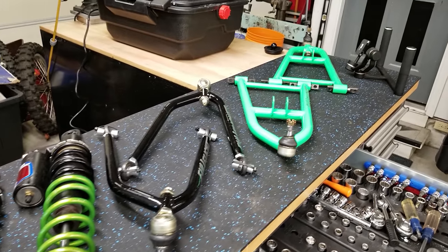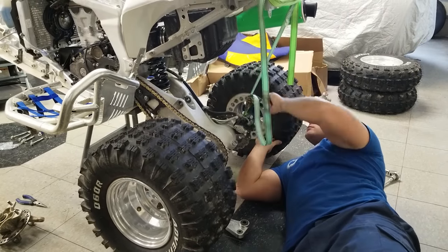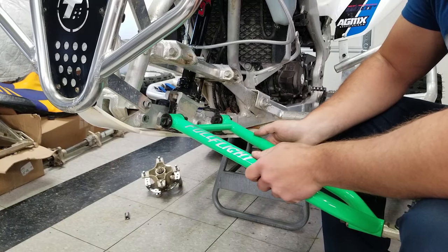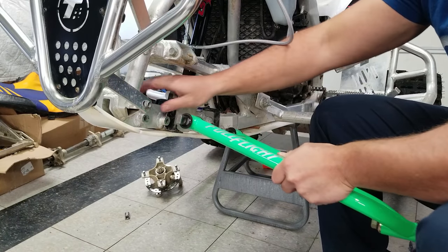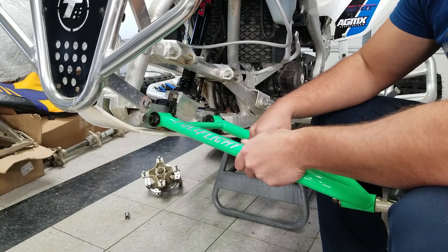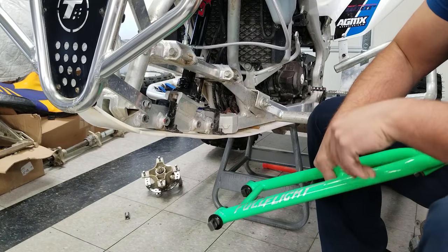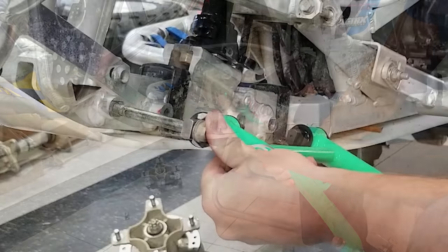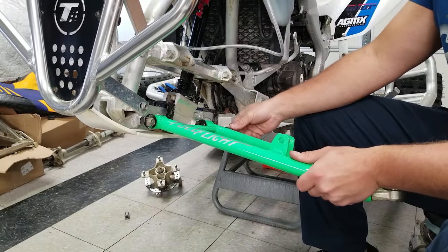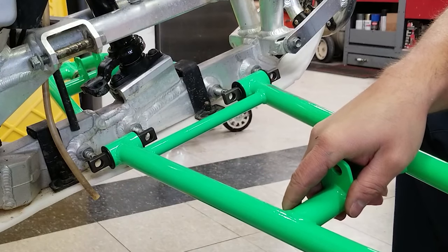Let's get the suspension and A-arms on. The first thing I did was install the rear shock - nothing really crazy here, pretty much just slides into place and bolts up. I won't be tightening down any of the bolts on the suspension until there's some weight on the machine. The KFX has kind of an interesting system - usually you have A-arm bolts that go through like this, but because it's such a narrow frame they decided to do it differently. You put these up here and then there are bolts that go through and bolt both sides of the A-arms on at one time. Then there are these little place keepers that kind of clip on - nice and snug.